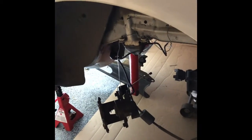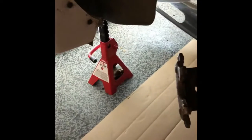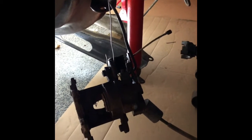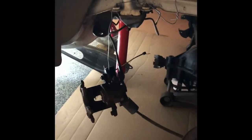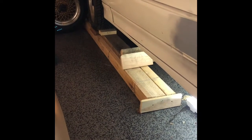So this will be 3rd of 4 videos I'm going to make. This is my rear end swap I'm doing. Right here is my rebuilt 9-bolt. I built it myself. It's a 3:27 ratio, Borg Warner. It's a cone style posi. So next time I work on it, all I have to do is connect the drive shaft, torque arm, my Panhard bar, got a tubular, also have tubular control arms, polyurethane bushings with nipples, grease fittings, and not to mention, I did this all myself, except I needed some guidance putting it on my homemade ramps here.